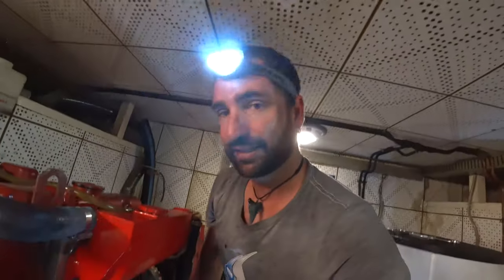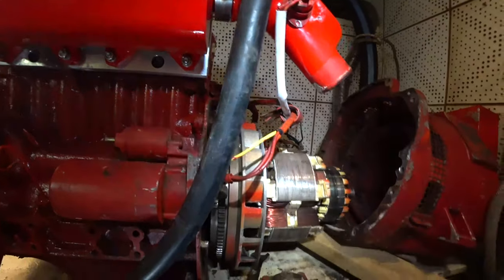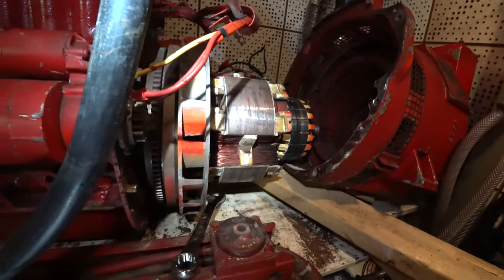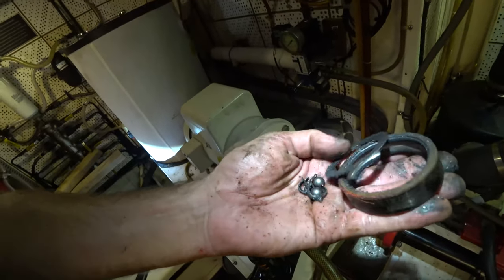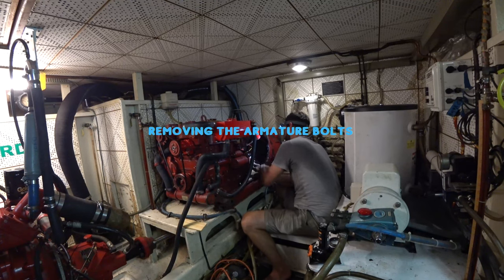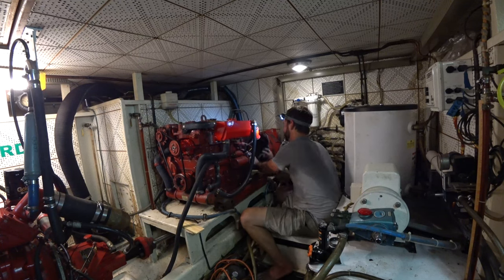All right, so we got the back end off—it took some finesse. Essentially you had to just pry it back, keep wedging screwdrivers in there, and keep the wood underneath since it's quite heavy. And here's the armature. I would say the bearing went bad. There she is—what's left of her. All shredded up—there are the balls that go in there. That goes on the end and back into that bell housing. Sure enough, that's what happened: the bearing failed, dropped down, and tore some stuff up. It really looks fun.